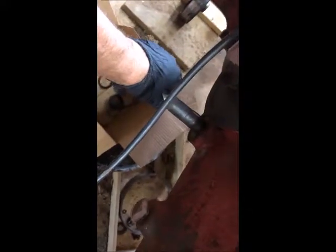The brake clutch shaft, which is right here, looks to me like just a rod that runs all the way through, but I get it this far out and then something solid stops it. I don't know if you can hear that or not. But I guess the workaround is I've got to see if I can get this Woodruff key out right here. That has been a problem on some of the others getting it out.